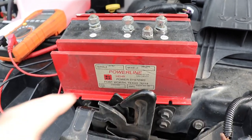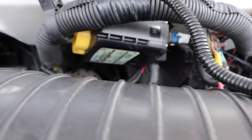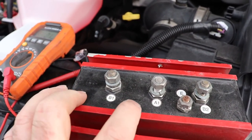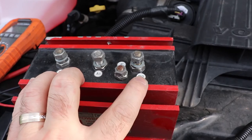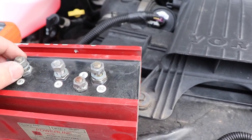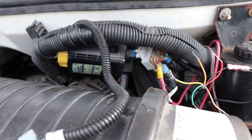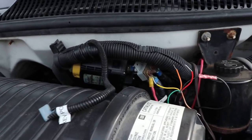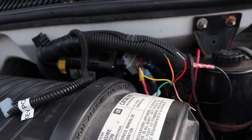In this video we're going to go over the basics of replacing a 150 amp battery isolator and putting in a 500 or 600 amp automatic relay into a Road Trek. It's not really too complicated. You have your battery one terminal, alternator terminal, signal terminal, and the coach terminal. These are 5/16ths posts and the new relay has 3/8ths posts, so what I did was take a pair of side cutters and snip the terminal ring and just barely spread them open a little bit so they fit over the posts. The other option would be to use a rat tail file to open up the connectors, or just re-crimp new connectors onto the wires.